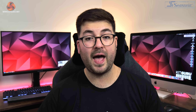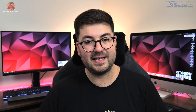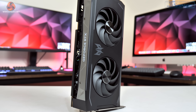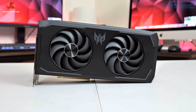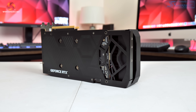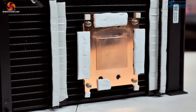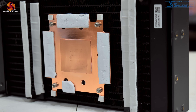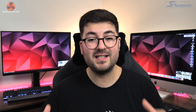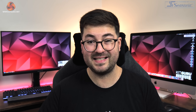So that brings us to the end of this video and I have to say it has been a very interesting time testing out this Acer 4090 — unfortunately for Acer, interesting for all the wrong reasons. As we saw, this liquid-cooled Acer 4090 just does not compare well to any of the other 4090s we have tested. It simply runs both hotter and louder, with particularly poor memory thermals, and it even thermal throttled when we noise-normalized to 40 decibels. Contributing factors include thick 3mm thermal pads that don't make great contact with the memory modules, the design of the copper cold plate itself, and the question of whether a radiator this small, built into the shroud of the graphics card, actually provides enough cooling power for a 450-watt RTX 4090.